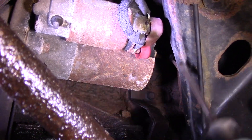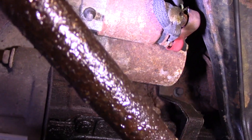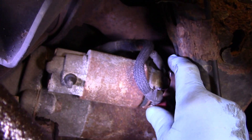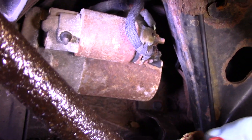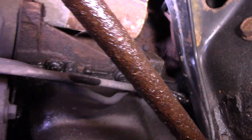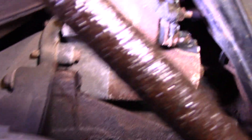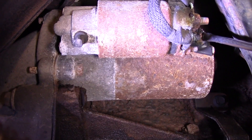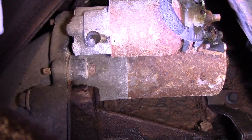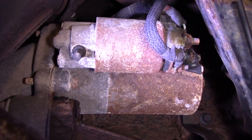This is actually the original starter in this car, so we're going to get this cover off. Don't lose it because we're going to put it back on. And you can see already — see how it's oxidized? Remember I was telling you about that wire? See that wire right there? See all that oxidation on there? Those wires frequently break off, and that's the problem right there. All right, let's check power and ground first.